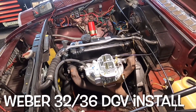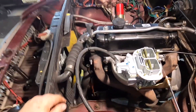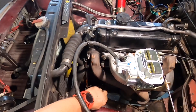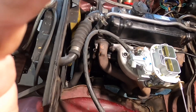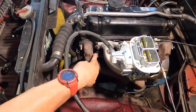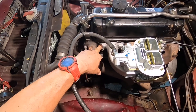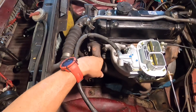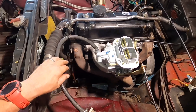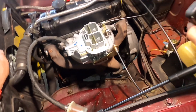This is a continuation of the pit repairs. As part of the repairs I had to fix the oil leaks on the two covers on the side of the engine. I've repaired them, but when doing so the studs were not great in the cylinder head, and the washers weren't the proper ones they should have been. When I put the original SUs back on they leaked, so I went ahead with this carburettor conversion that I was going to do a bit later on anyway.